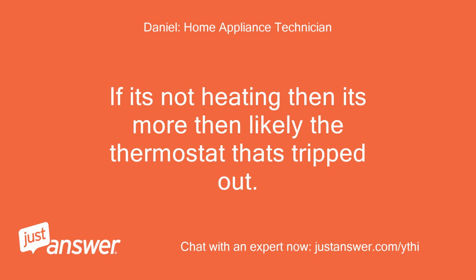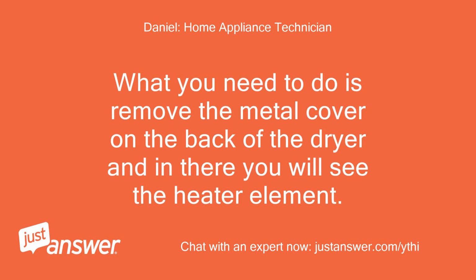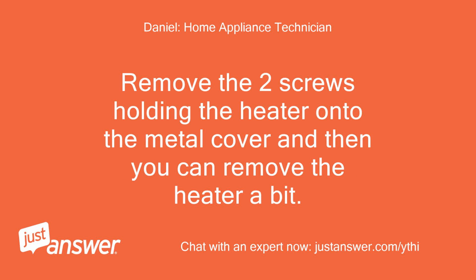If it's not heating, then it's more than likely the thermostat that's tripped out. Make sure the dryer is unplugged. What you need to do is remove the metal cover on the back of the dryer, and in there you will see the heater element. Remove the two screws holding the heater onto the metal cover, and then you can remove the heater a bit.